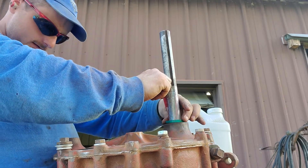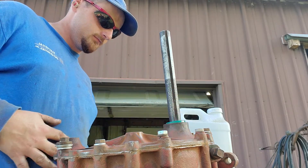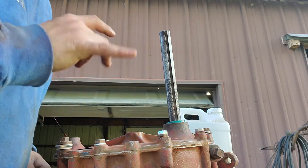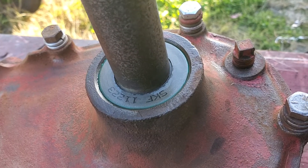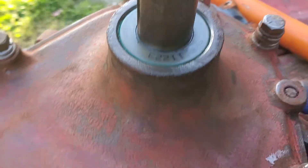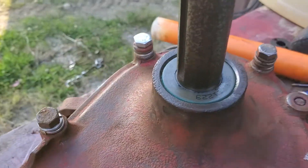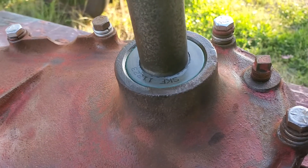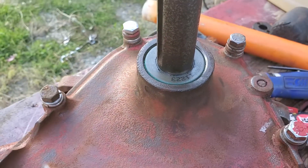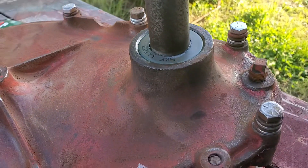Slide it off the plastic and pull your plastic out. What you're looking for is just the seal to be flush on that bore, not really sticking down much more. Always use two seals — I've used one and had them leak. The original seals are twice as thick as the ones you get nowadays.